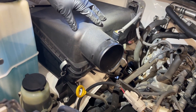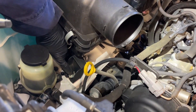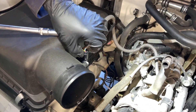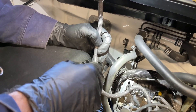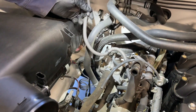I don't want to have to work over the top of this thing. It looks like it's held to the body with two 10 millimeter bolts — one in the front and another one over here, and if you go to the back side, there's another one down there. I'm going to disconnect the electrical connector to the mass airflow sensor first — squeeze it and pull up. There's a plastic clip that attaches the harness to the air box, and I'm going to use some needle nose pliers to get that out.